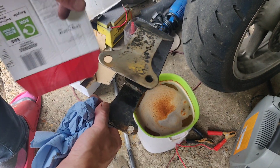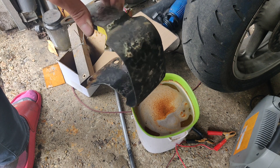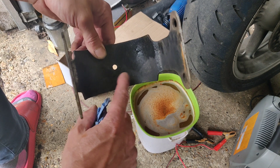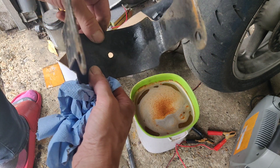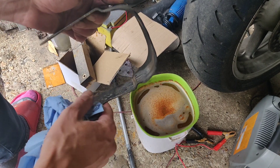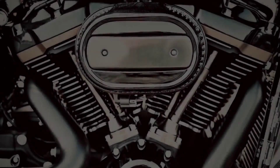I think that's salvageable and usable. So home electrolysis rust removal — another little tick in the box of things you can do really simply and incredibly cheaply. Particularly on bits where there's no way you'd get a grinder in to grind away at the stuff — absolutely not a chance — and it's actually done a brilliant job. It means I can reuse a 40-plus-year-old bit of metal, put a new cap on it, and use it to hold a new mudguard. All good in the hood — cheers all, catch you in another one.